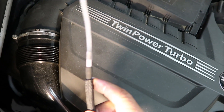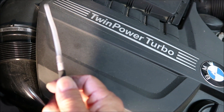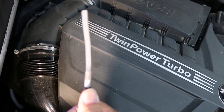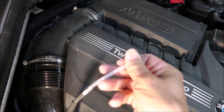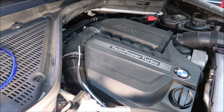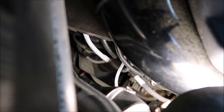Here's the view of my repair. All I do is cut off an inch off the existing tubing. Put a little coupler here — and this is silicone. I'll make my connection with the silicone hose; that should last a long time. There's a little bit of a bend there, so there's some stress on that hose, but silicone should be much more durable than rubber.